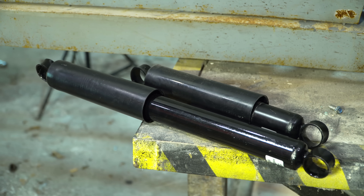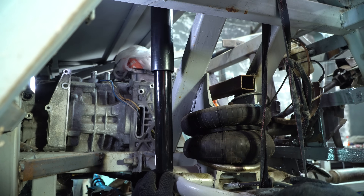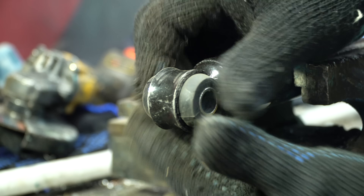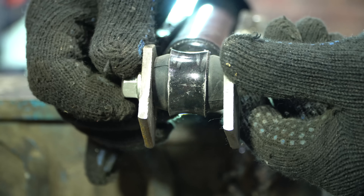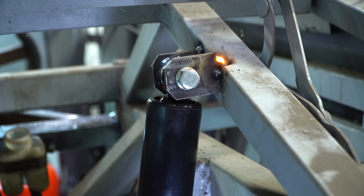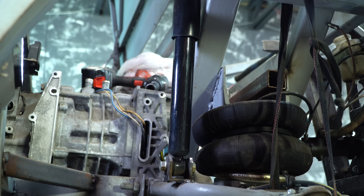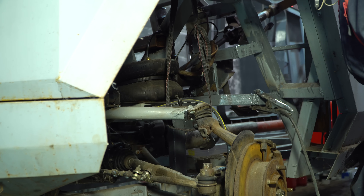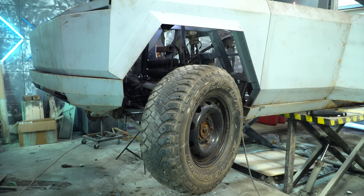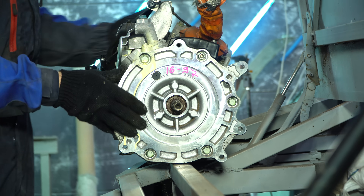Further go the struts. We need to finally install them before I break the pneumatic cylinders. I found the most suitable place for the front struts. We need to make a mount for them and weld it to the frame. I stopped at this variant of suspension travel. If necessary, the wheel can be lowered by another 10 cm due to the remaining margin. Before I had time to install all the struts, the electric motor EM61 got delivered. I dropped everything to focus on connecting it to the control units.